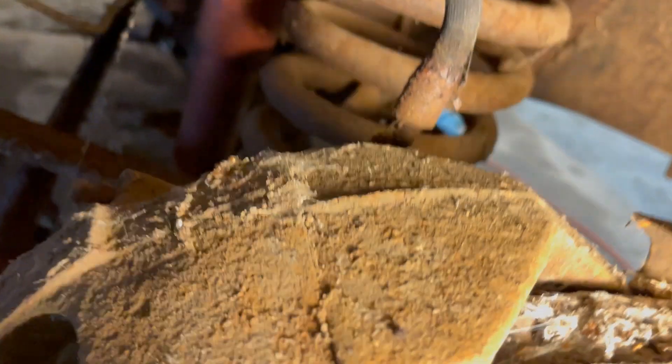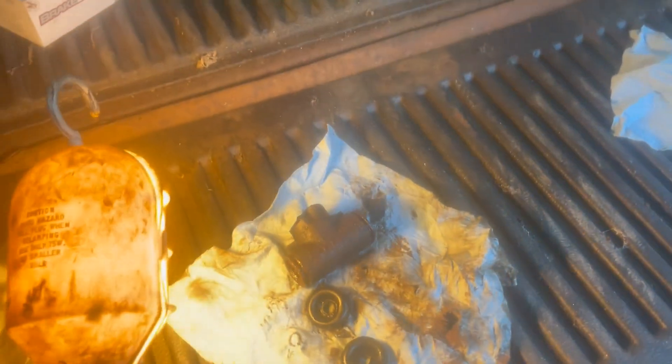I'm back at it on the truck. I found a leak in the rear brake cylinder — I was wondering why the fluid ran out over a day or two from the rear side of the master cylinder. I found a very small leak out of the left rear wheel cylinder, so tonight I change it.